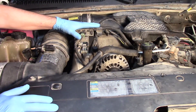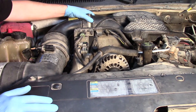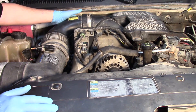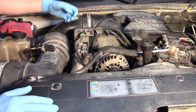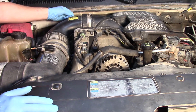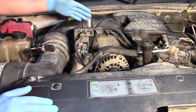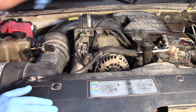Now that we've got everything reinstalled, we've done a double check to make sure all our pigtails and connections are remade, all our hose clamps are tightened back up, and all our bolts are good and tight and torqued down to the right specifications. We're gonna go ahead and make sure we top off the coolant because we did lose a little pulling that EGR cooler off. Keep in mind a couple of the tips we used: going through the backside with the bottom stud and making that one go in last gives you an easier installation, and also removing some of those studs as well as routing the coolant hose back behind the alternator makes it a lot easier to remove the part as well.